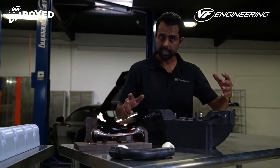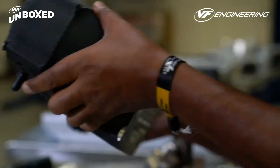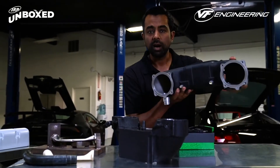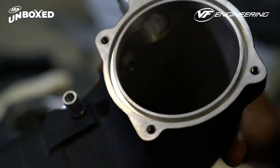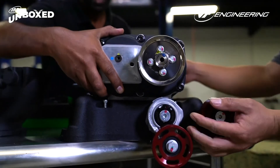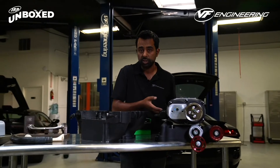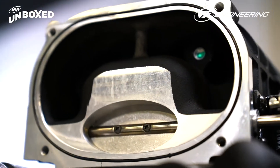One of the last pieces of the hardware system is the air intake for the supercharger. This was made 10 years ago — hogged out of a block of aluminium — designed and tested for pure prototyping. That was then created in SOLIDWORKS CAD and then we created a cast finish: a 356A aluminium casting with press fit and push fit fittings. And then we ended up with the final piece — the supercharger's actual compressor head unit from Magnuson with the Eaton TVS 2300 rotor group, our own manifold with integrated air-to-water heat exchanger, a tensioner system, internal bypass system, and the inlet which mounts to the back.